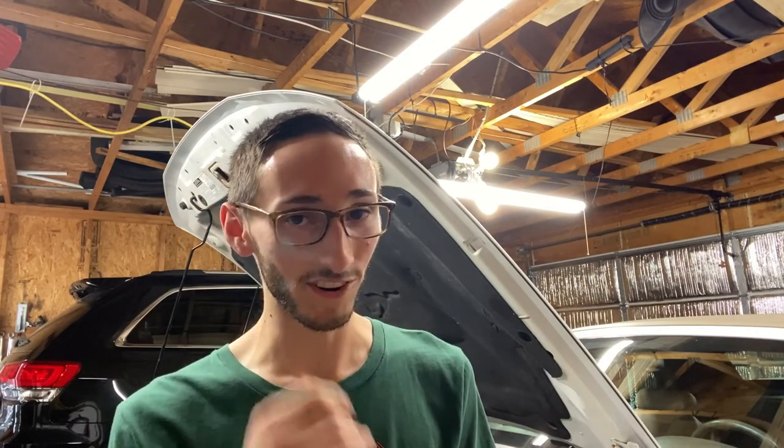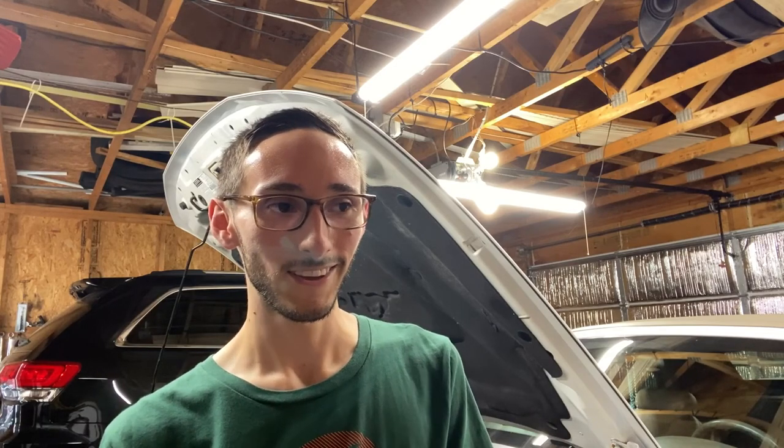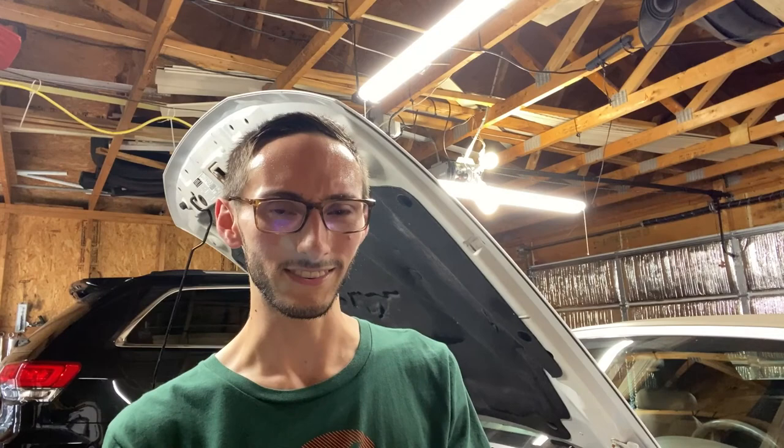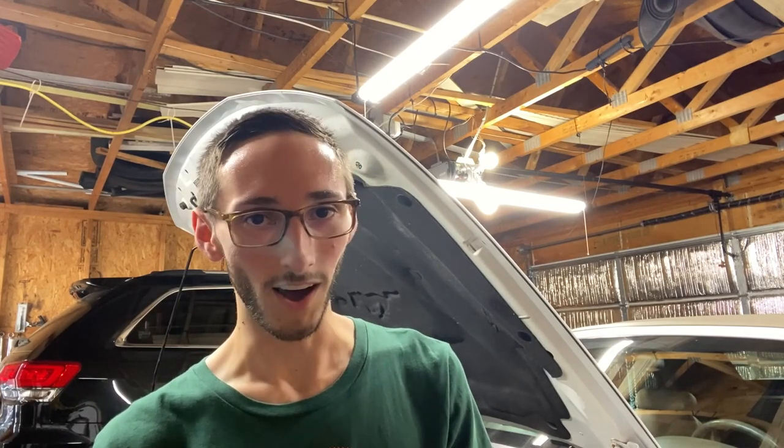OEM's pretty good stuff, if I've got to be honest. I've done a lot of research. Everyone just says OEM stuff is good for like 7,000 RPMs. That's crazy. And as long as your cam tensioners are metal and they're the ratcheting design, you should be fine. But I wouldn't go buying the cheapest set you can buy. Don't get the cheapest eBay special. Do it the right way.